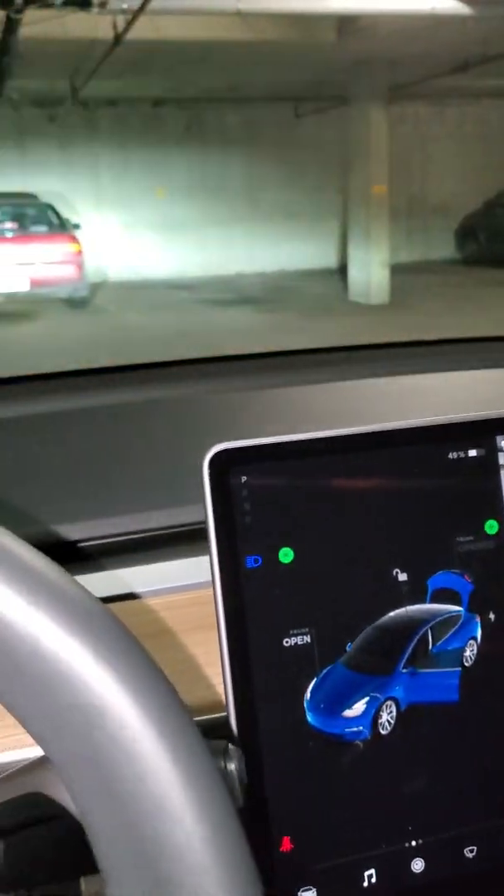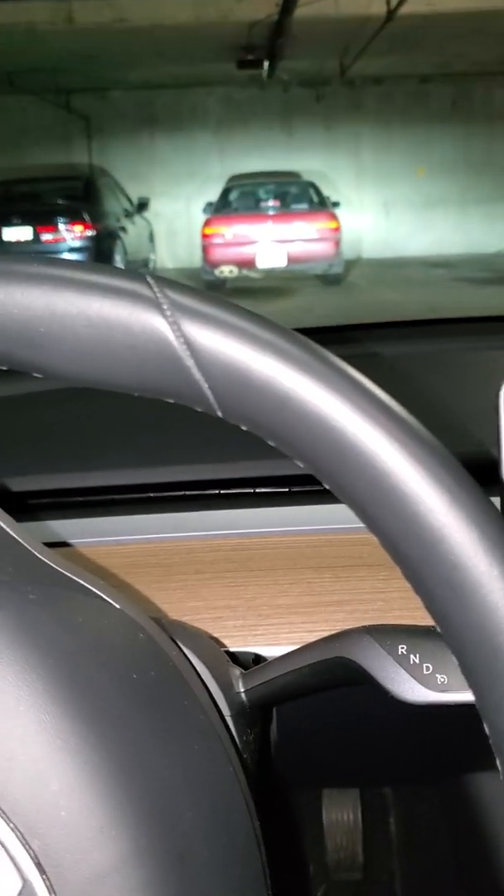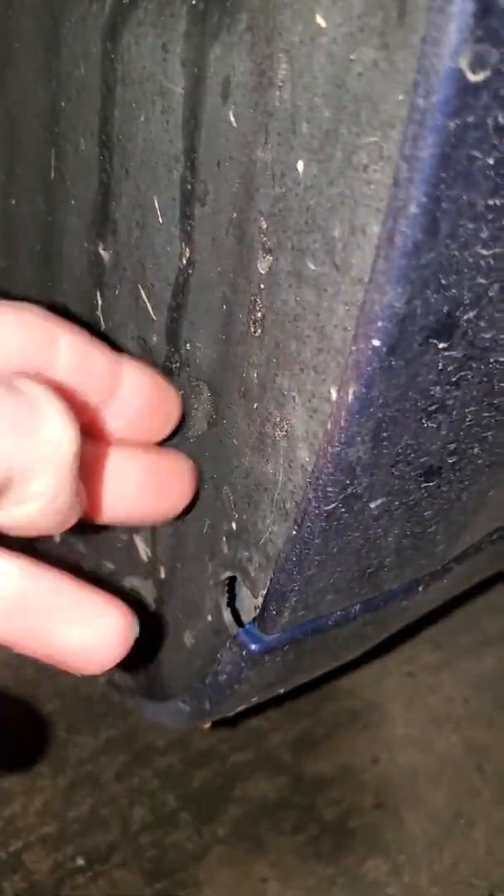Just ran it, kind of tucked it and pulled a few panels. To actually get at the repeater wire, definitely a bit of creativity. What I recommend doing is turning your wheel all the way to the left if you're working on the left side, the driver side. Then you have a little bit of room to work with. There are these two little push things — plastic rivets — just pop them out. Then you can kind of reef this back and stick your hand up to get in.